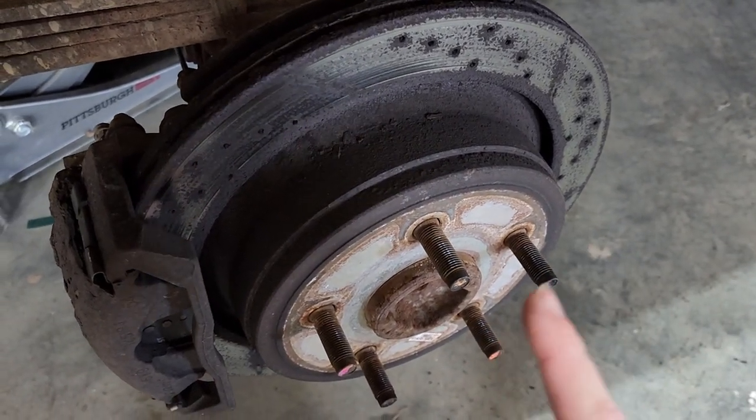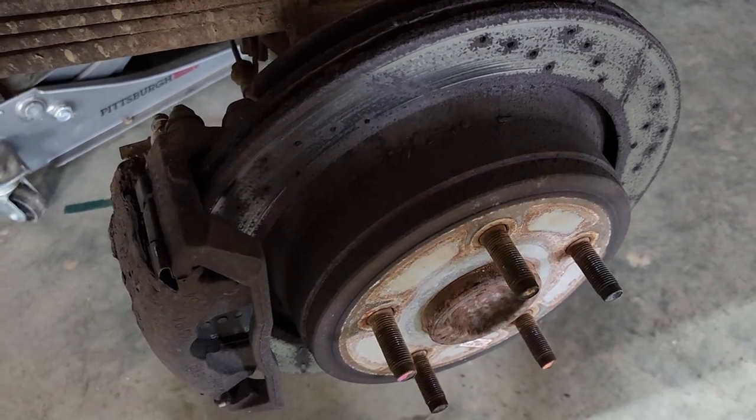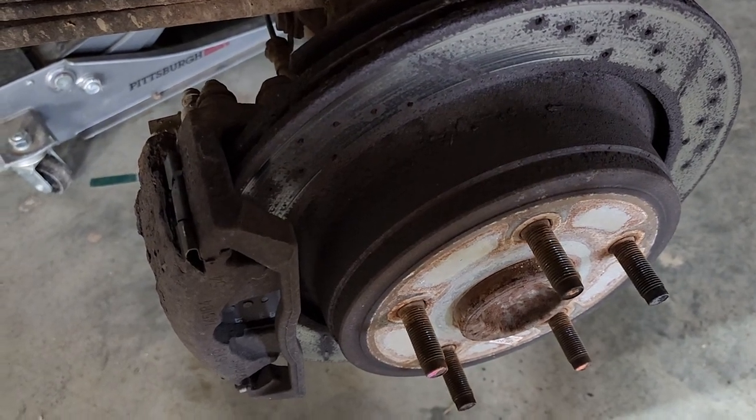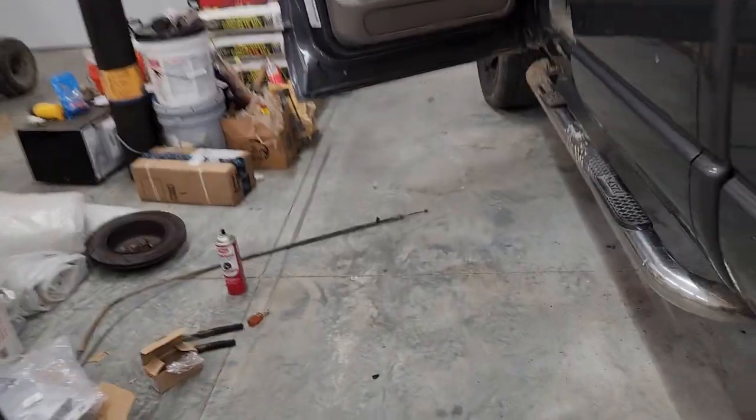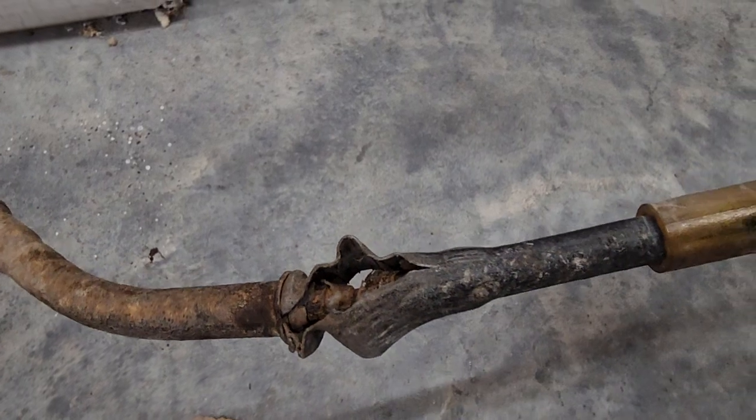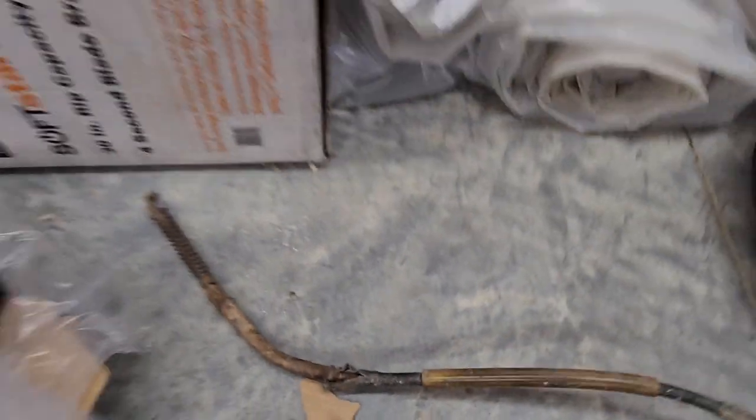I took those off and didn't see any real issue with the shoes themselves, but I did find out that on these trucks your emergency brake cable goes right there into that assembly. On the other side, the cable was basically locked up. When those lock up they can cause other issues — one being the emergency brake not working, but it also makes things worse. From the pressure of hitting the brake it basically completely ripped the cable open, so I had to replace the whole entire cable, which is the shorter one.